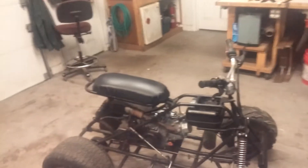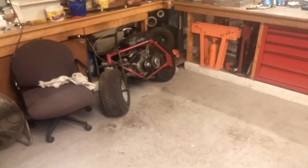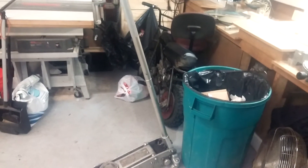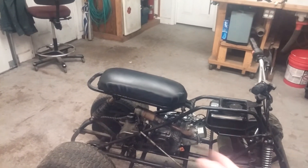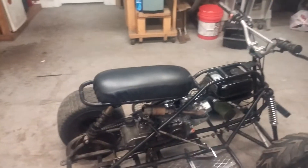This thing is really fast — fast as hell for a 212 Predator powered vehicle. I've never seen anything like it. A torque converter has no chance against it — that torque converter sucks up like 30% of your power just to operate it with all the slip. This has all the benefits with direct drive and three separate ratios — direct chain to chain, no belts to slip, as little power loss as you can have in a system like this with three gears.